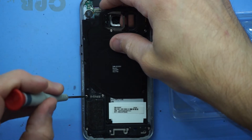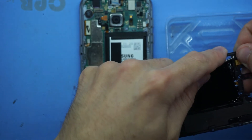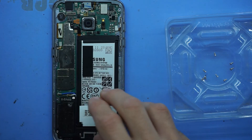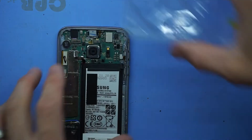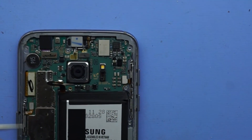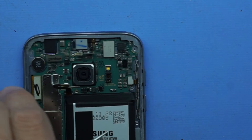So now, with all those screws removed, I only need to remove the top half — out of the three pieces, just the top two. I'll pop those screws out so we don't lose them. Back to the phone itself — disconnect the battery, and then I'm going to disconnect both the connectors at the top here. I believe one of these is the earpiece speaker, the one on the left. The one on the right, I think, is the ambient light sensor. I'll disconnect both of them, just in case I get it wrong.